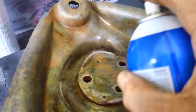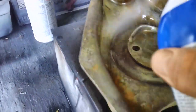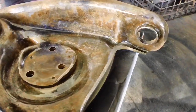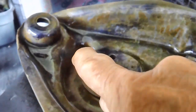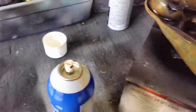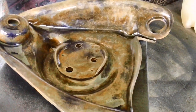Watch what happens — as soon as I spray it, it attacks that rust and turns it black. There's a little bit of wind around here now. You need to spray it and get rid of that before it starts eating away again. Don't just put it back in your car or try to paint over it — make sure you spray it. Now in a little while, that whole thing will just turn really black, just like you see it right here. The places where it wasn't quite as thick, it attacked it really quick. I'll probably have to go down and pick up another can of this — I hate to do that with this coronavirus business, but I've got to do what I've got to do.